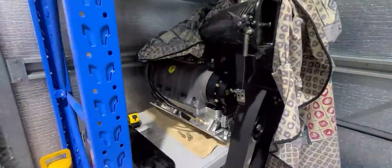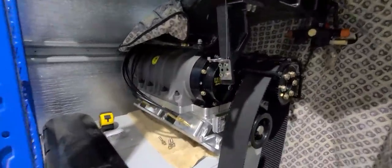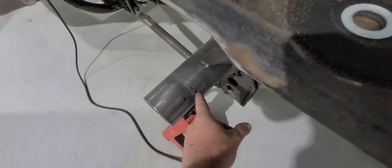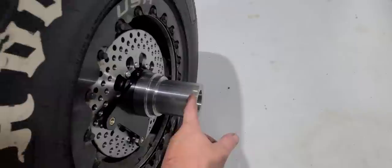I plumbed all this up the other day - looking good under there. After I get the Enemies Rollbar installed, I've marked the diff where I'm going to cut it, around here. I've got it machined about one mil off here so that it slides into the housing nice and tight, and then there'll just be a weld pretty much around here to hold it on. That's the next step after the Enemies Rollbar.